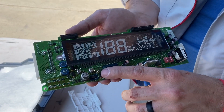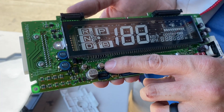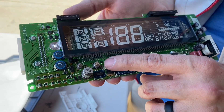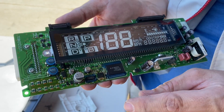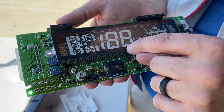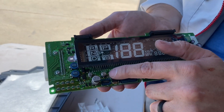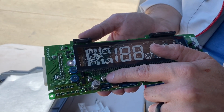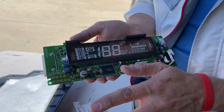The capacitor we're going after is right here — it's a 100 microfarad, 16-volt polarized capacitor. You can see the negative side is right here, so make sure when you put your new capacitor on that you get the polarity right. Otherwise it won't work, and that's a lot of time spent just to test it out. We're going to desolder this one, get it over to the bench, get the new one soldered on, and put it all back together.